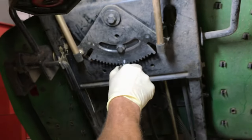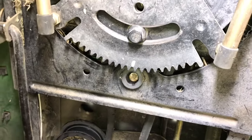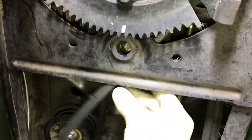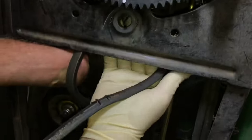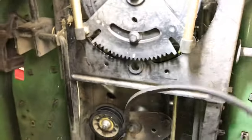This should come down and you can take this off — just be careful there's a collar in here, it's got to stay pretty close. I'm going to go around and pull up the steering, trying to get it to come up straight. I have to come up probably about six to eight inches, just enough to get the belt to come through. About six to eight inches — so the steering wheel is sitting up about six inches at the top.